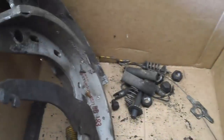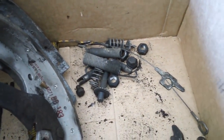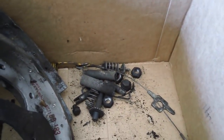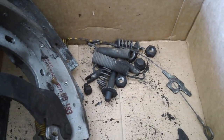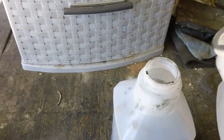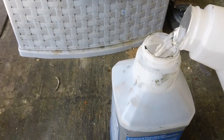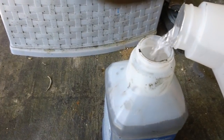What I'm going to do here - all these little loose parts - we're going to stick them down inside this bottle of paint thinner. I'm just going to stick them down in there, put the cap on it, and every once in a while come out and shake the heck out of it. Everything that would fit in there has fit in there. I'll add a little more paint thinner to fill it up and cover every one of those pieces. I'm going to let them soak for two, three days - I'm in no rush.